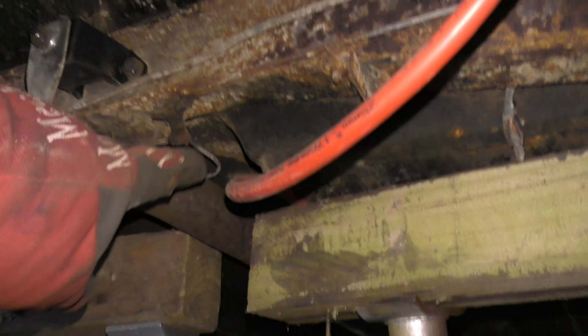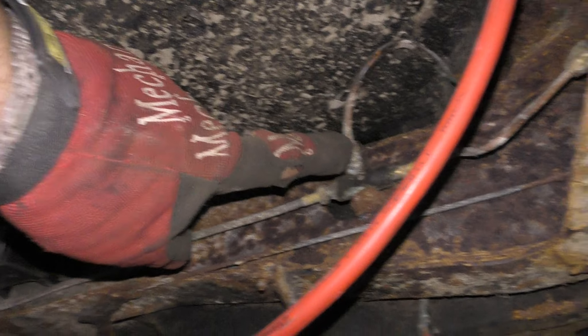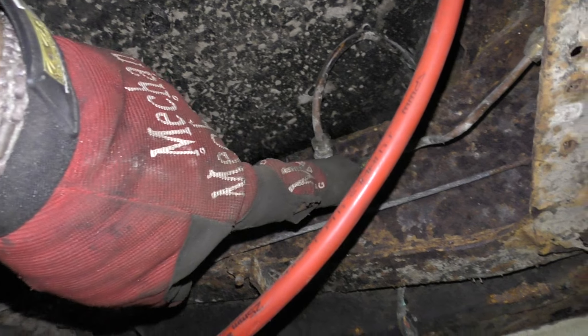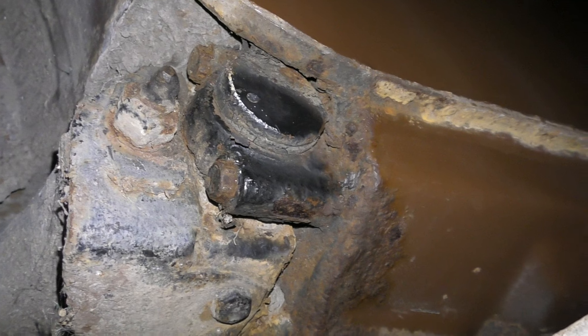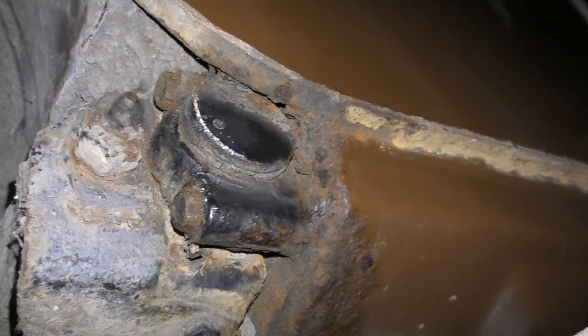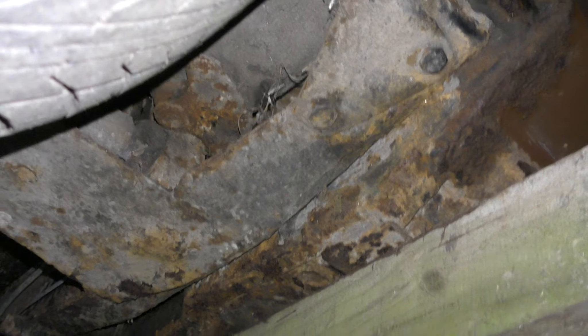The handbrake is already disconnected because I didn't connect it up. I'm going to disconnect this bracket here — this pipe — that is the front to rear pipe. I'm going to take it off with all this stuff still intact. Hopefully that's going to be the best option. Then I've got two bolts here and here, and the same this side up here — two bolts there going into the heel board. These are the ones I'm concerned about, the ones I think are going to snap, because when you look at the condition of that heel board it looks like it's seen better days.